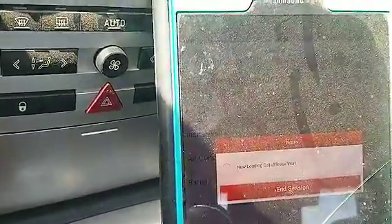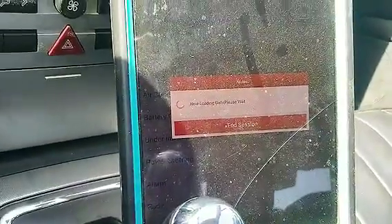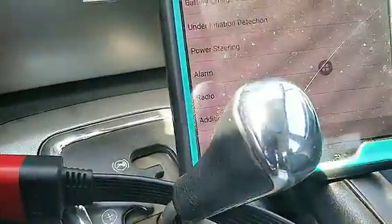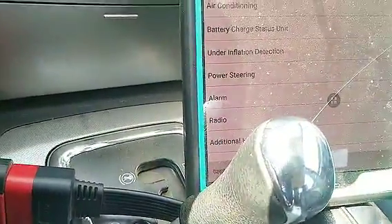I don't want the transmission system to have any real problem, so I'm going to go check another system — the anti-lock braking system. That's the system to talk to in this situation because it's about a fault. Okay, it seems like the ABS is having a problem communicating. Whoa — why doesn't the ABS want to talk to us?